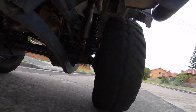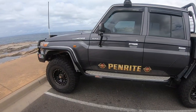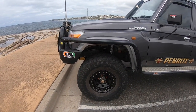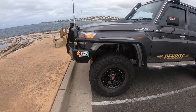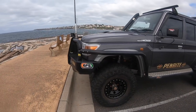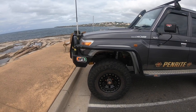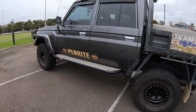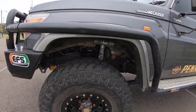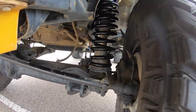In the next video, we'll be putting on the 35x12.5x16 inch Trepidors. We'll go out for a day trip, ramp it up, do some hills where it's going to articulate, and get some measurements. Then the same day I'll be putting the sway bar back in and running the same tracks and lines, taking measurements to compare with and without the sway bar — because the sway bar does limit travel, but how much and is it worth taking off for your off-road adventures? Until the next one, thanks for watching.